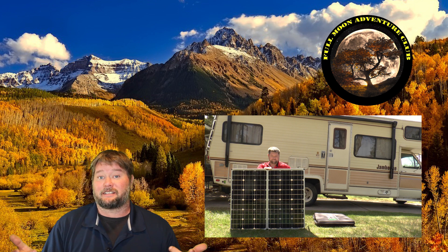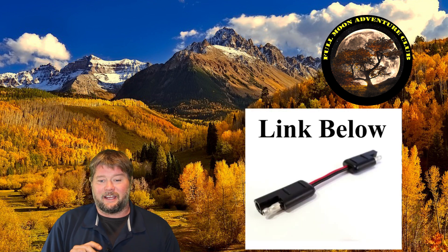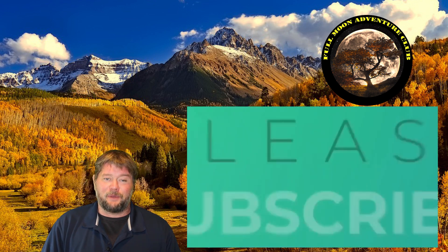I get that question a lot — people think you can only use a ZAMP solar panel with that plug. While that might be the easiest way to go, and I have a ZAMP solar kit 120 model kit — they are well built and I really like mine a lot — if you already have a different kit, all you need to do is check the polarity and either you'll need that little switcheroo plug or you won't. I'll put a link in the description below that'll take you to the switch plugs with that connector type, and that should help you out.